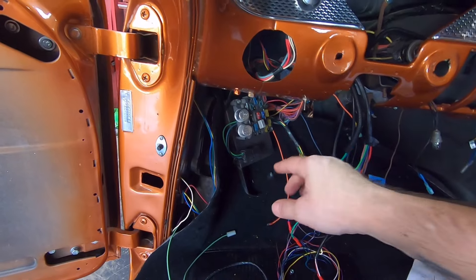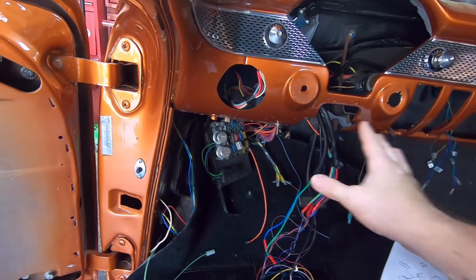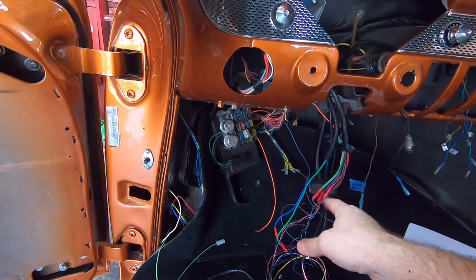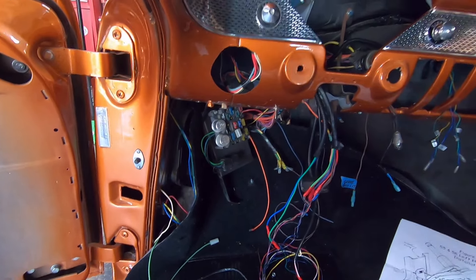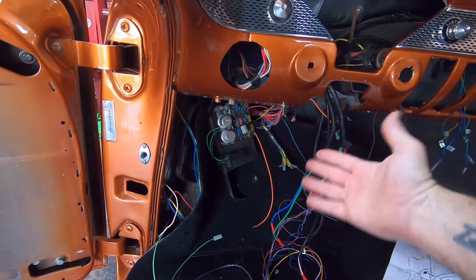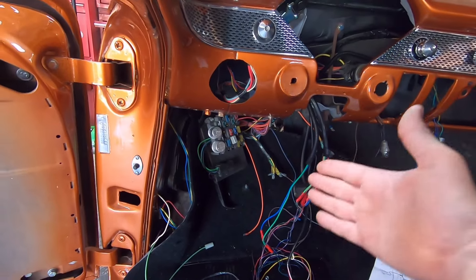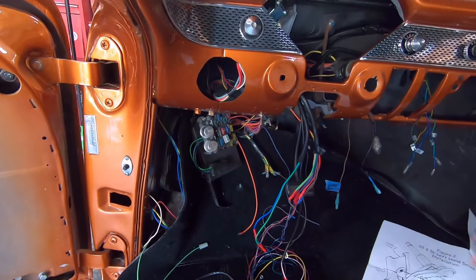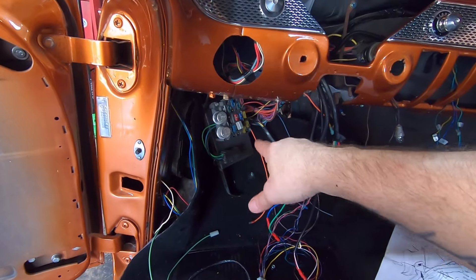I love the kit. If you're just doing a basic 55, 56, or 57 Chevy, the 12-circuit is just fine. But if you're adding power windows, cruise control, and all kinds of add-ons, you probably need the 24-circuit because it'll have all the extra circuits for lots of other things. Steve's car is pretty basic, though he's adding on a few other things — it's probably getting close to the limit on this harness, but I still think we're going to be fine.